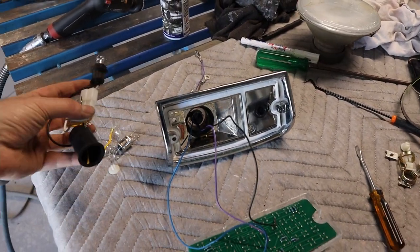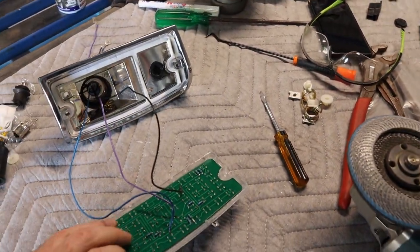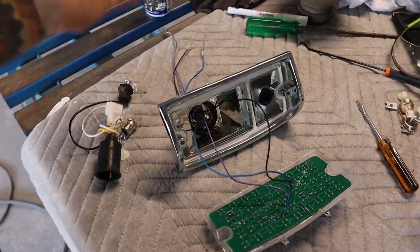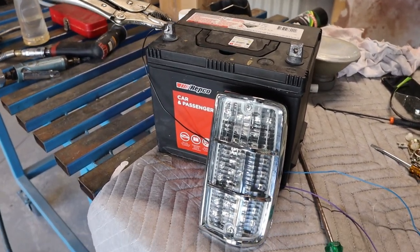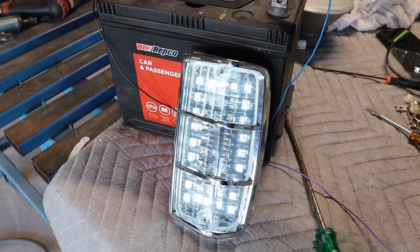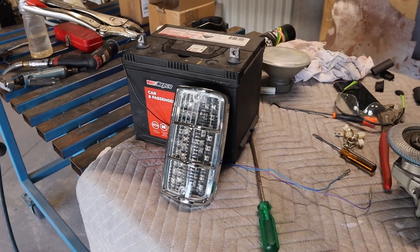For the LED indicators, you just pull out the two bulbs and the wiring — you don't need any of that anymore. The LED board sits in the cover, and that cover screws back in. The wiring feeds through and a grommet comes with the kit to blank off the old hole since it's not needed anymore. It's a pretty basic kit — no modifications needed, just wire it up. Testing with a 12-volt battery: there are three wires — black to earth, purple for indicators, and blue for parkers. They turned out pretty awesome, so a big thank you to Daz for sending them out.